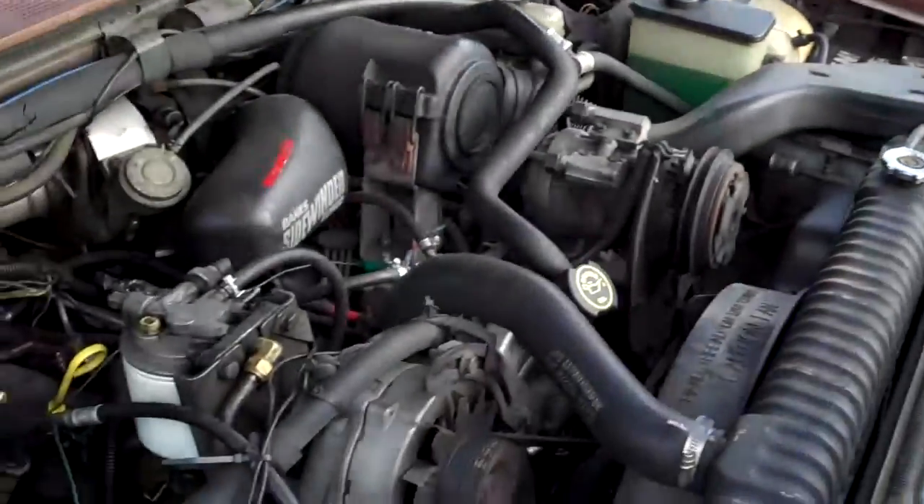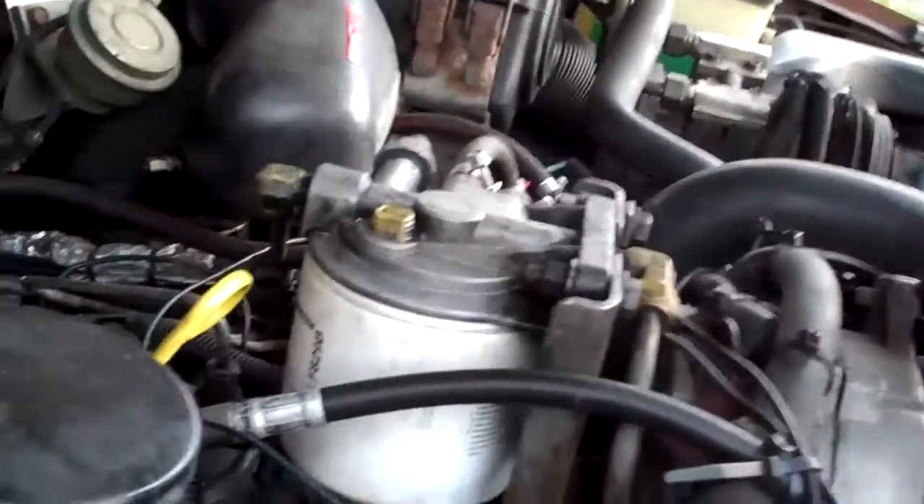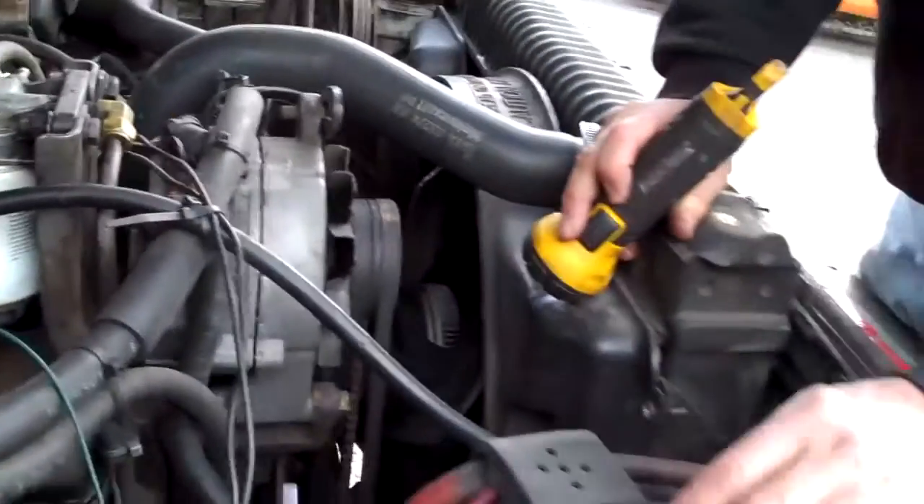As with any vehicle, you want to make sure that you have lots of good, clean, filtered fuel. That means don't run it with a plugged filter — you run with a plugged filter, you can cause all kinds of trouble. The truck can quit running; you can ruin the injection pump, on and on. So to change the filter, it's just a simple screw-on filter right there — unscrew it. We like to pour the fuel into a clean container so you can see what came out. You want to make sure it's just 100% fuel, not dirt, water, or bacteria. Anything that's not fuel is bad — if you wouldn't drink it, your truck doesn't want to drink it either.